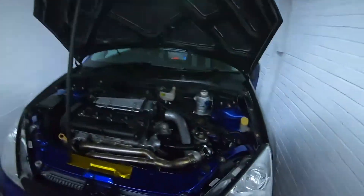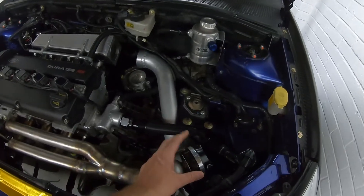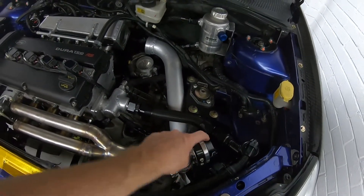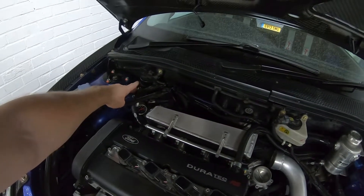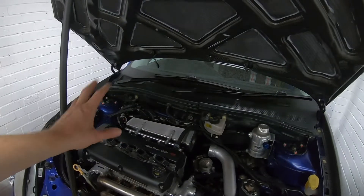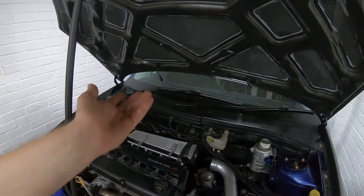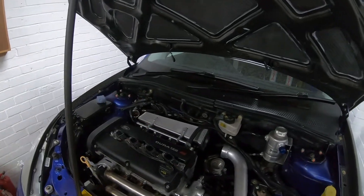I've also upscaled the injectors to 875cc instead of 650s. I need to get it started and progress — the throttle body is over here and I still need to sort all the boost stuff. The wastegate needs a MAC valve, it's got a 14 psi spring, so I need to mount that. It's currently 45 psi static, which is fine for starting with no boost, but it needs a boost reference so as inlet manifold pressure increases, it compensates to match.